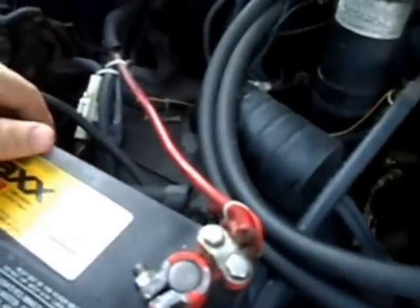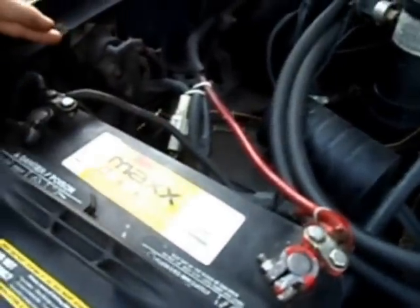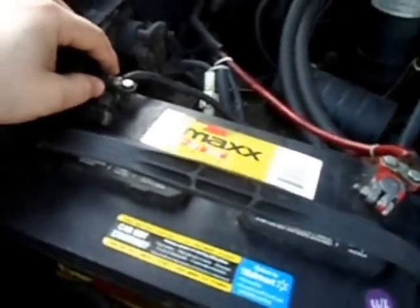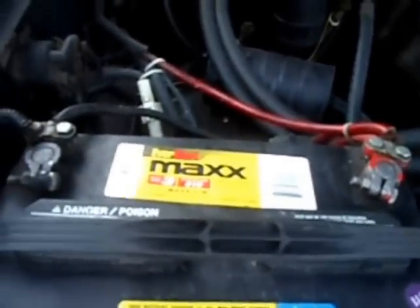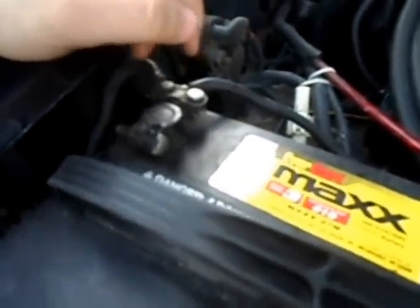Another little reminder with Ford wiring: always make sure that your grounds and stuff are clean. As you can tell, this little ground right here goes straight to your battery, and then it goes on around to your block and frame. I had an issue with the truck just randomly not getting power at all, and it turned out that this ground was not good. Just cleaned it off and power was restored — it just was not making a complete circuit.